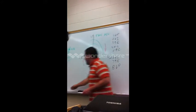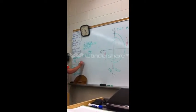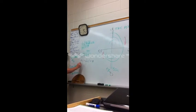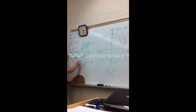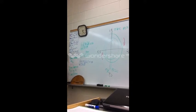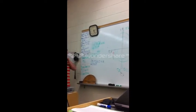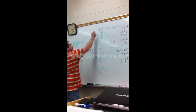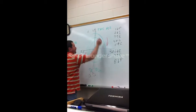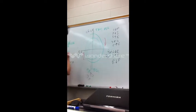Okay, now rather than redraw this, we're going to put the other firing order on here as well. 1, 3, 7, 2, 6, 5, 4, 8. So we split it in half. 1 and 6, 5 and 3, 7 and 4, 2 and 8 are all mates, right? What do we notice? Same mates are the same mates. It doesn't matter which order we put them in, they're still mates. So, 1, 3, 7, 2, 6, 5, 4, and 8. Everybody okay with that?